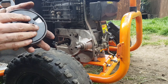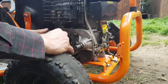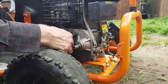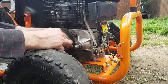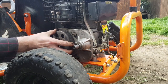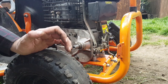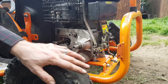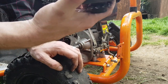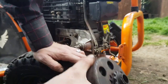Yeah, it's a dodgy clutch. Things are rattling about all over the place and it was loose on the actual shaft itself. If we can get it back on — look at the wobble. There's mega play in the outer casing. So it's the clutch that's bad, and the tyres have got a slow puncture. So I'll order two tyres and the clutch should be here today at some point, because that's what I suspected was wrong. We'll wait for the postman and we'll be back soon.